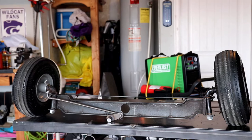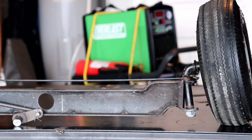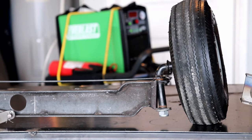To be blunt, if you look at that, it worked, it did its thing, but it just doesn't look good. And then the steering knuckle was part of my problems. You can see how bad the wheel's wearing like that, because I just had 10 degrees camber.